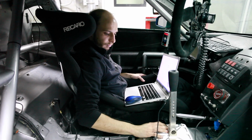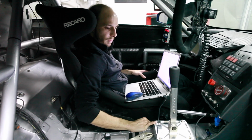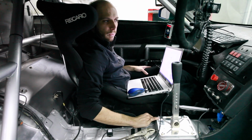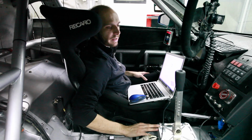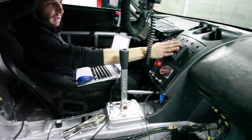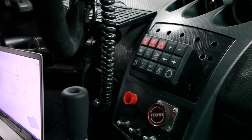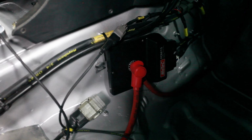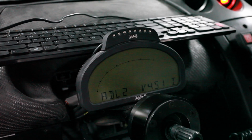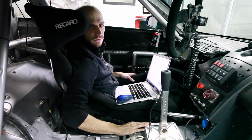All right, Sash, so since the last time we saw you, you've obviously finished off the gearbox install. What else has changed in the car since then? Yeah, so Motec also worked with us this year, and they provided us with this PDM. Now we've gotten rid of all the switches, relays, fuses that this car had, and everything is done now through the PDM and through this nice keypad. Oh, cool. Yeah, so we've got automation of all of the power functions. We can now log and monitor the currents and draws and statuses of all of our circuits. We can program functions based on inputs into the ECU or the dash. Everything communicates over a network here, so we now have all sorts of features that we didn't have before.